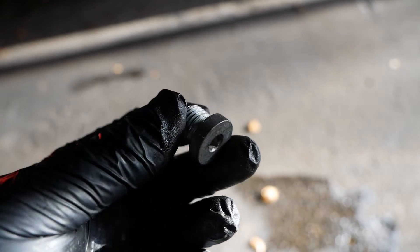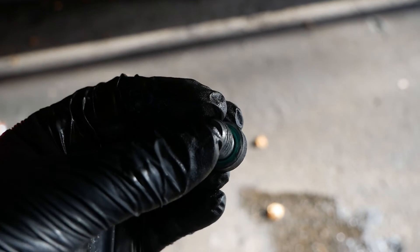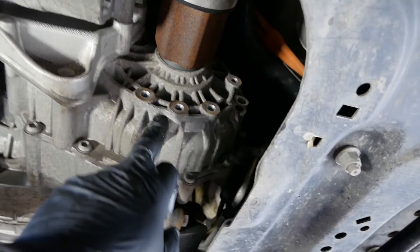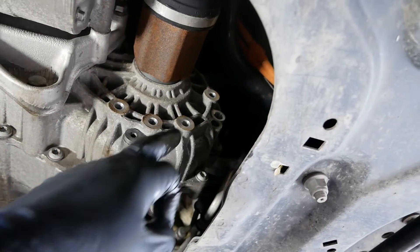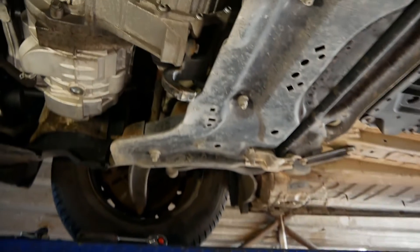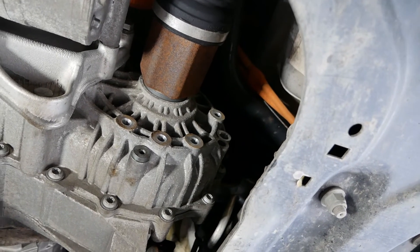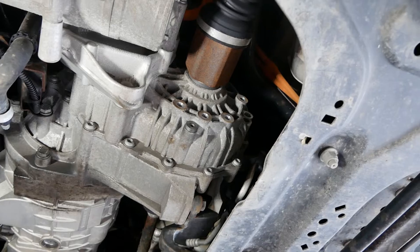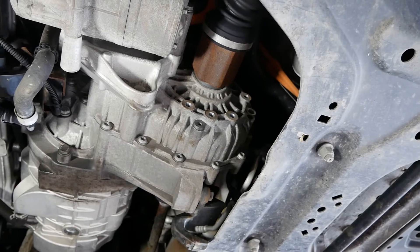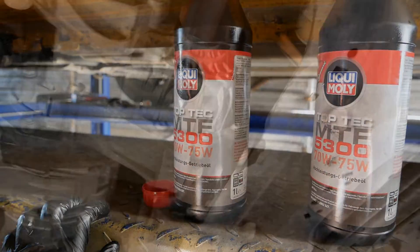The manufacturer obviously thinks you shouldn't be changing the oil anyway, so you're probably meant to buy new plugs if you do this. I don't have those, so I'm going to reuse them — generally that's fine, but I'll check it's not leaking before the vehicle goes out. Put your drain plug back in and tighten it up, then fill through the fill plug until the oil starts dribbling out. I'll use a syringe for this — you could also use a hose and funnel from the engine bay but that tends to be messy. Right, that's done and I can confirm it took exactly one liter, so just one bottle is needed for this job.